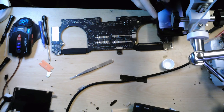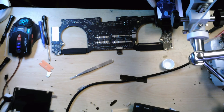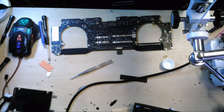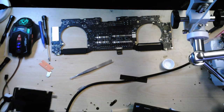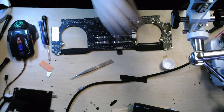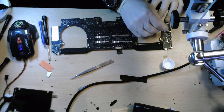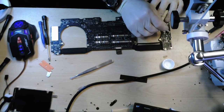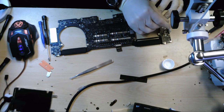There. Yeah, and I think that is all of it there. So it really does seem to be concentrating mainly on this other side here. Let's get back under the microscope and get in with our Q-tip. It's just amazing how much damage just a little bit of water can do, corrosion wise. Again, we're going to look for components that potentially are loose, or have cracks in them.